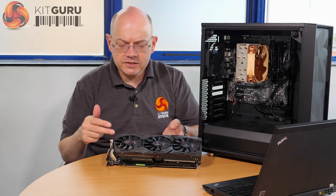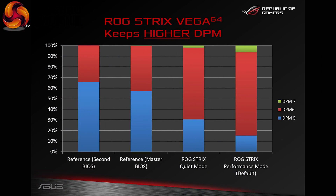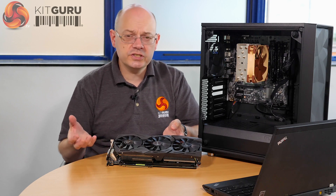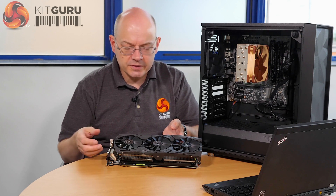In the case of this ASUS card, the max clock speed is 1630 megahertz, but the point of interest is what it actually runs at most of the time. That is what a decent cooler gives you — a larger percentage of the potential max clock speed. You're interested in the usable clock speed. For this card, it's 1500-something megahertz — how much exactly remains to be seen.